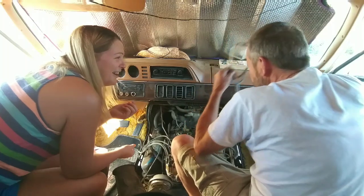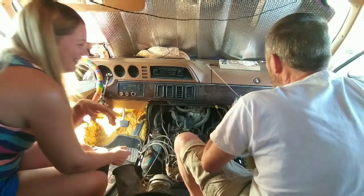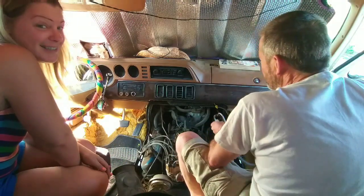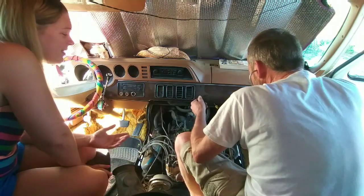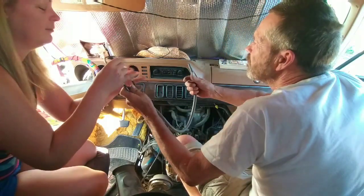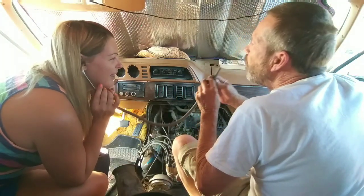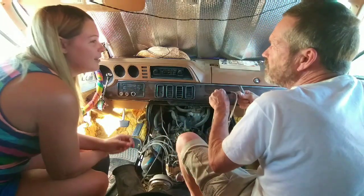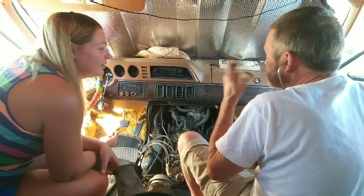You're going to take its temperature? I'm going to listen around the base plate of this thing with the stethoscope, because sometimes you can actually hear a hiss if there's a vacuum leak. Well, the whole thing hisses. Yeah, but when it started. Oh, that's like a doctor's stethoscope. Yes, it is. That's cool. It's a mechanic's stethoscope. So see how you can pick stuff out of all the rest of that noise. I want to do this because it only takes a sec.